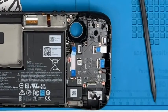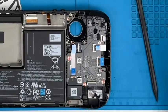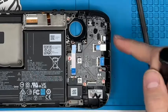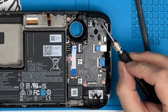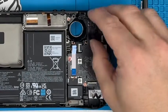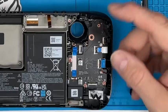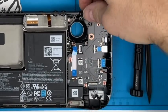Then we'll go for the bumper button. 2 screws, 1 and a 2. It's interesting that it actuates through the switch, the bumper button's there, and there's a magnet in here and in there that detects that, kind of like a Hall effect sensor for the trigger. Now that lift should, well, that will lift off anyway with that, and also the bumper will come out. No, it won't, because that's the plate underneath.